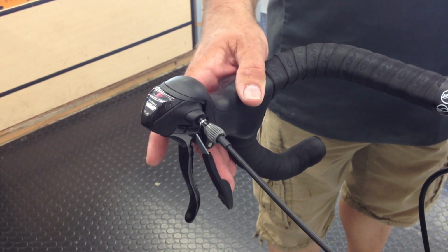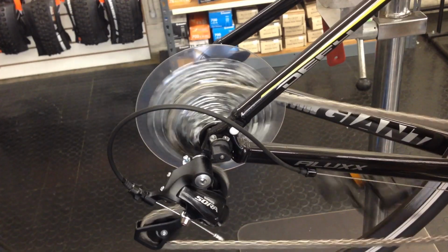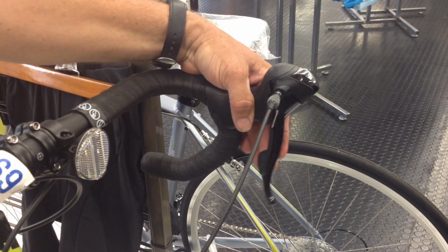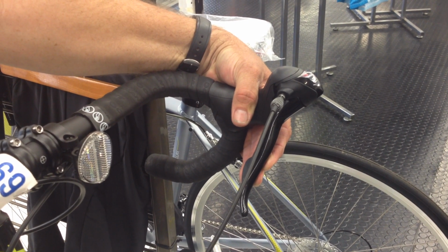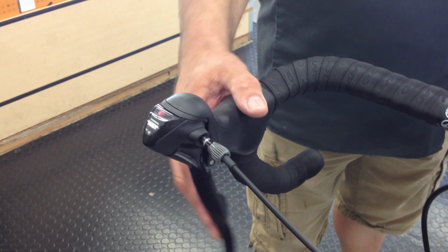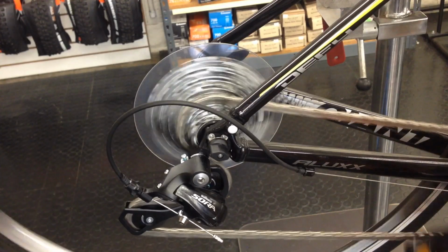Right is rear on a bicycle, so use the inside shift lever on the right side to go through your gears. When you get down to the 5th or 6th gear, shift the left lever up to the big chain ring, of course while you're pedaling. After you've shifted to the big chain ring, go through your gears again, this time with the full lever, taking them up to the 2nd gear.